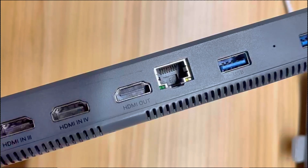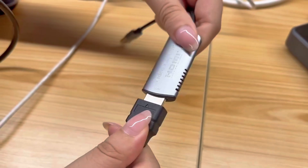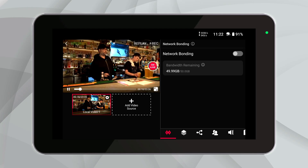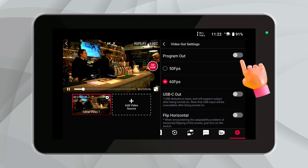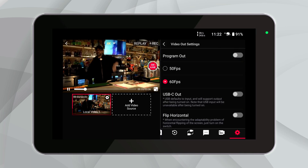Windows computers do not need to consider this point, as they provide support for both USB and HDMI ports. When plugging in the cable, insert one end of the HDMI cable into the HDMI out port of the device, and connect the other end to the HDMI port of the Video Capture Card. Then connect the other end of the Video Capture Card to the computer or USB-C hub. Next, navigate to the Settings interface by clicking the Gear icon, then enter Video Out Settings, and enable Program Out. This step allows us to obtain a program that only presents the content from the top left corner, rather than the entire screen information.